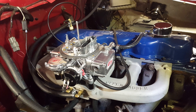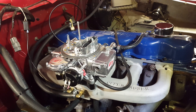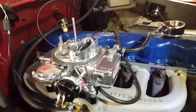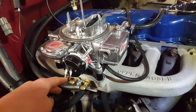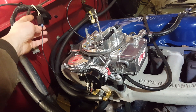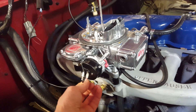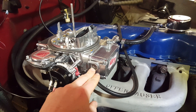So I was at a crossroads this year — either put EFI on it or go with the Quick Fuel — and I elected the cheaper route of the Quick Fuel. I wanted to give a quick video with my impressions after just having it a couple of weeks. So far it's really impressed me. It's a four-barrel vacuum-secondary, electric-choke carburetor. You do need 12-volt switched power for the electric choke, and luckily on the firewall there's a blue wire with 12-volt switched power, so I was able to use a bullet connector for that, which made the electric choke hook-up really easy.